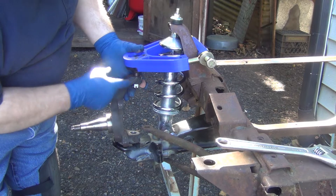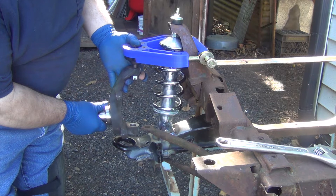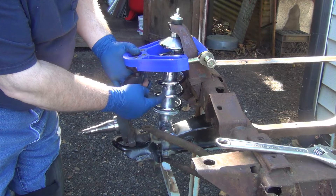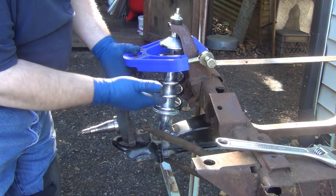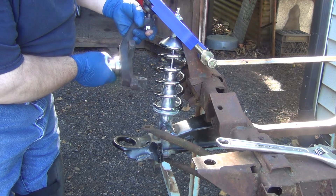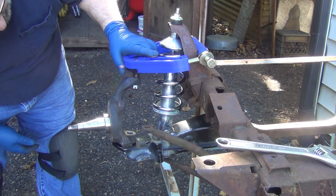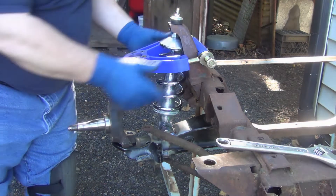This is a hard-body spindle and I've got it loosely mounted up there now. That's going to sit on the ball joint probably about there. Keep in mind this arm is going to be up a little bit because there should be about an inch of compression here with the vehicle riding on it. That's roughly where it should be set — if it's three inches of travel, you want one inch of extension and two inches of compression. This ball joint probably has more travel than the Chrysler one. This is the only one I'm really concerned with because I've got to figure out that length.